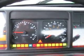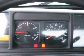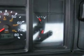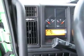You can see the lights come up and hear it come to life. The motor has not been pre-warmed up — it starts like that when it's cold. This truck comes right to life. You can see we've got the oil pressure gauges working, fuel pressure gauge, everything's working wonderful. If I rev it up, we've got about 85 pounds of oil pressure at about 1,100 RPMs. The charging system — everything's working great. With that, I'm going to hop out of the cab and we'll make our way under the hood.